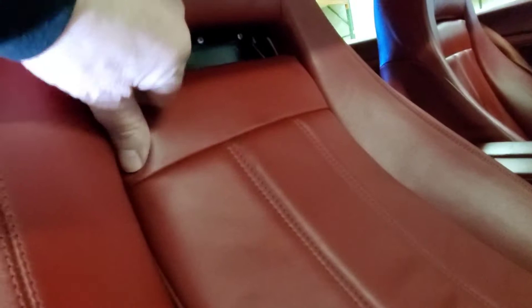So you have your backrest panel. What you're going to do is reach your hand in here. Work it under there. Work it in good and lift up. See it coming out? Now you'll want to go in here with your hand and work it over. Again, I'm doing this with one hand so it's kind of tough. But you see that little clip right there? You want to protect your leather. So push it way over on that side like that, push it over. Now pull it out, and then put these underneath and rest everything on here.